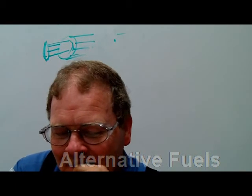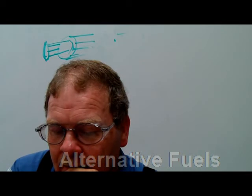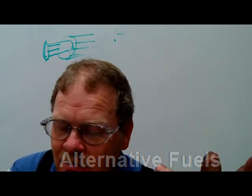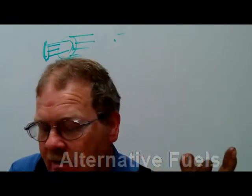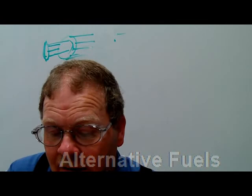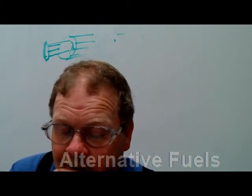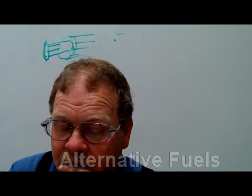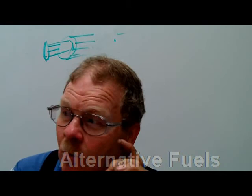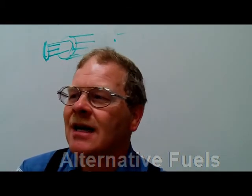Okay. Now then, where are we going? Nine to one. Okay, I'm sorry. We're on 10. Technician A says the stoichiometric ratio for gasoline is 9 to 1. He's a yo-yo. He doesn't know what he's talking about. Technician B says the stoichiometric ratio for ethanol is about 9 to 1. Which technician is correct about that? B is correct on that one. 9 to 1 is good for ethanol. You see the difference? You need 14 to 1 for gasoline. You need more fuel for ethanol to get the job done. That's why you're not going to get as good a gas mileage.